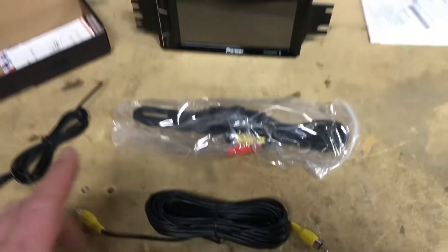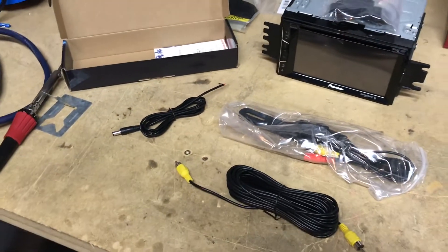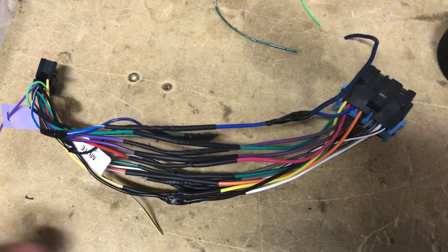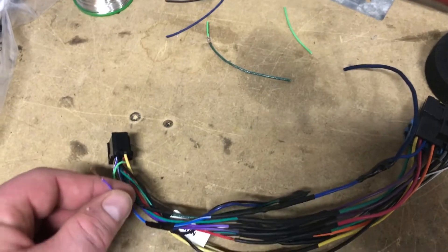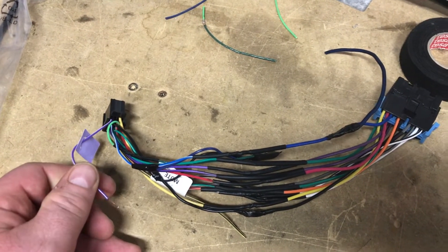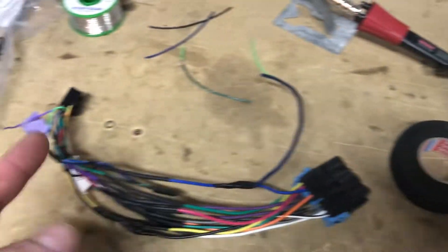Just as a quick note, if you have any questions on how to wire one of these up, I have a video on the channel where backup cameras are explained, so check that out. We went ahead and connected all our wire — we used heat shrink and soldered everything up nice and tidy. We have our backup camera wire left out to tie in separately with its own cable. This is our trigger wire, which we'll run to the reverse light in the back. We're going to zip tie everything up and wrap it with tesa tape to make it look factory.